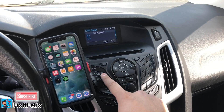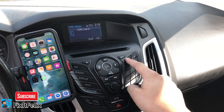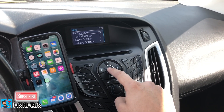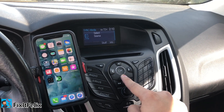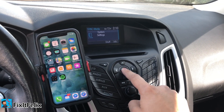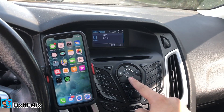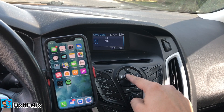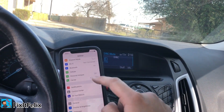Let's say you're in the radio option — just go to the aux, go to menu, click on Sync Media, scroll down until you see System Settings, Bluetooth Device, Add Bluetooth Device, press OK to begin pairing. Find Sync, click OK, and search for Sync on your device, then go to your Bluetooth options on your phone.